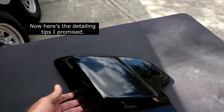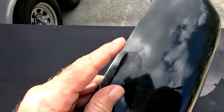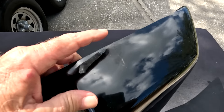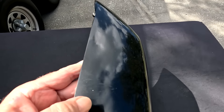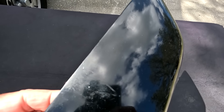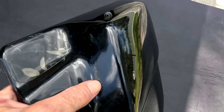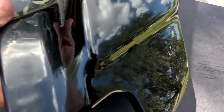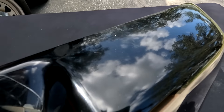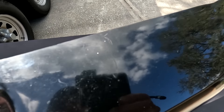This is a quick detailing video showing how I do this. This is the side panel for my 2007 Electra Glide. This happens on a lot of Harleys — the seat rubs against the side panel, scuffs it, and puts scratches in. There are some scratches I believe go through the clear coat that I may not get out, but I'm going to make this panel look as close to new as I can by first wet sanding with 2,000 grit, then polishing and buffing it out.